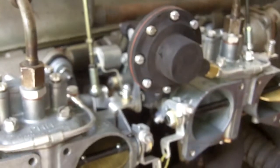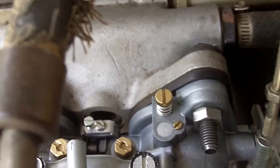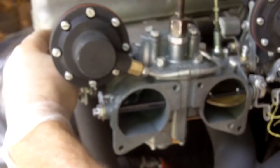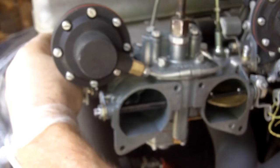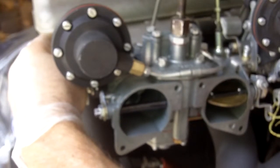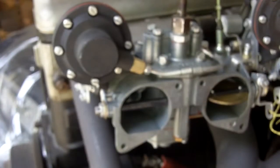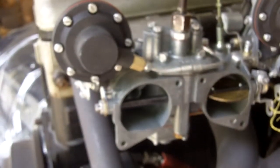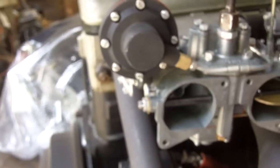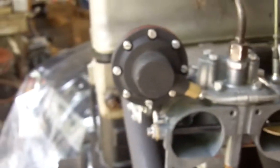The only other adjustment you can make in a situation like that is this little bitty set screw back here. Now, this little set screw right here — I'm going to adjust that and see if that's going to help us. What I'm trying to do is adjust it to where that little set screw, connected to the first barrel and your return spring, works on the second barrel butterfly shaft, and we'll see if maybe one can't artificially close the other. That helped a little bit.